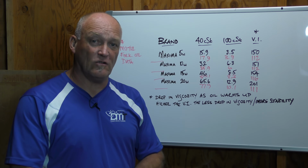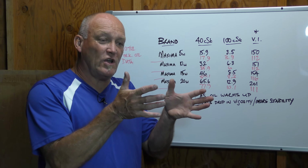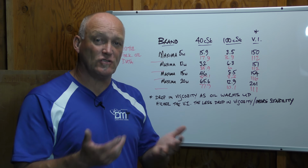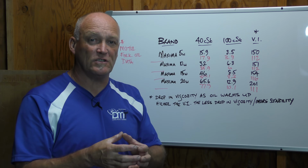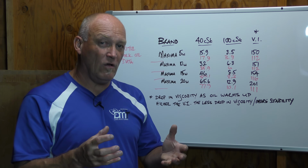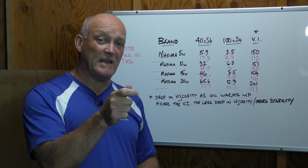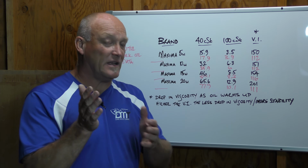And in a lot of videos, I am looking to see, can I buy oil first to use what I have to make it work better? And if I can't get it to that point with oil, what's the next step in financial expenditure, which is a revalve of the stock equipment if it's a cartridge and if you can get into it to keep the OEM pistons and redo the shims, or level 2, is it replacement components, which includes piston and valving that are engineered on a dyno and provided to you by a given company like K-Tech and Ohlins and Nitron, etc., etc.